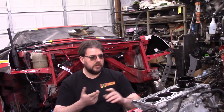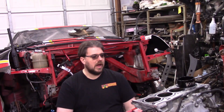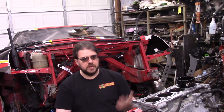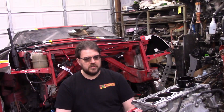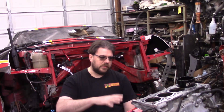We've done compression tests. This thing — depending which tester you're using, but we've used multiple — either 180 or 185 psi, which is about right for this motor. It's not like there's a factory manual for this configuration, but 180-185 for a 12.5-to-1 compression ratio engine seems spot on. Leak down test, no problems — it returned about 3 to 5 percent across the board. You want just a couple percent, and more importantly you want it to be even across the board and not needing to put any oil in there for things to seal up. So that wasn't the problem.